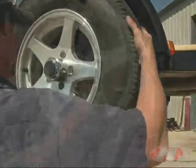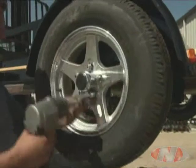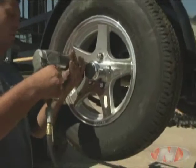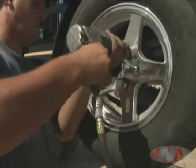The wheels can now be mounted. Screw the tapered lug nuts onto the lug bolts, tapered side in. Tighten down the lug nuts by partially tightening every other one to keep the wheel on straight. On the second pass, tighten the nuts down to 90 to 100 foot-pounds depending on the rim size.